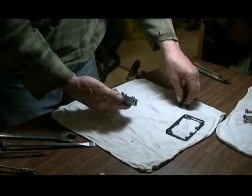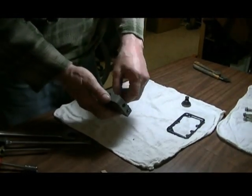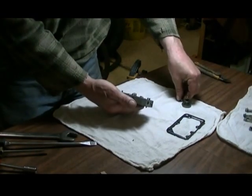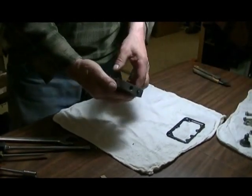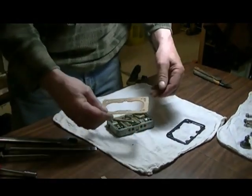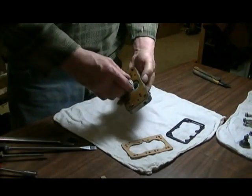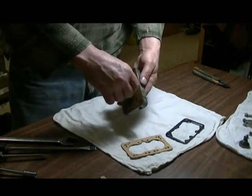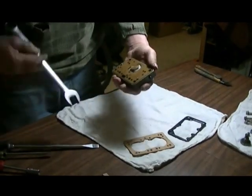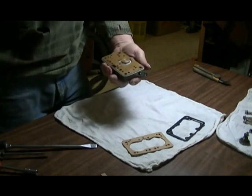Okay, take the power valve, it goes. Believe it or not, both jets go. Okay, done with those. Never again. You don't need jets. We've got a gasket here for this one. New power valve plug. It's just a plain plug. Blocks off any activity from there. Nice nylon washer on it, so it just needs to be snug.